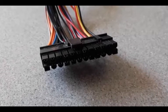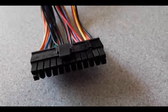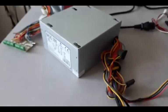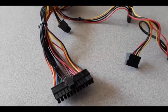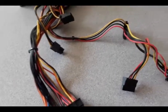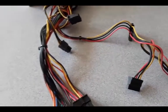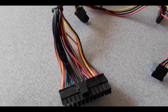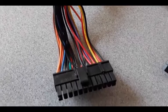Here's the pin connector of an ATX power supply. This one actually has the 20 pins of the older type plus the 4 extra pins that you can attach, coming off a power supply that my brother-in-law kindly donated. One important thing to keep in mind is that the wires are color coded: every yellow wire delivers positive 12 volts, every black wire is ground, and every red wire is 5 volts. My suggestion is to follow what the tutorial says, because the main connector also has some negative voltages.